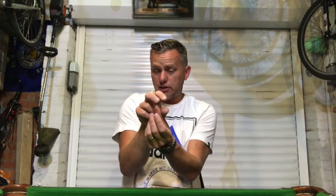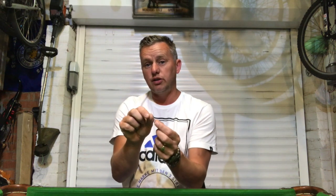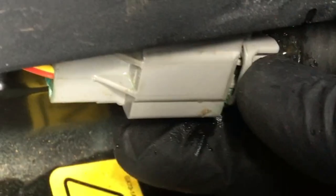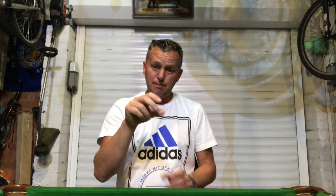Turns out this little connector plug at the bottom — that's been submerged, that's got corrosion on it. As soon as I cleaned it up, cleaned all the connections, dried it out with a hairdryer, gave everything a really good clean and dry, everything started working again. You can just see the green corrosion around the wires on the end of that plug, and that went right through to the terminals. That was it — all down to that plug with the corrosion.